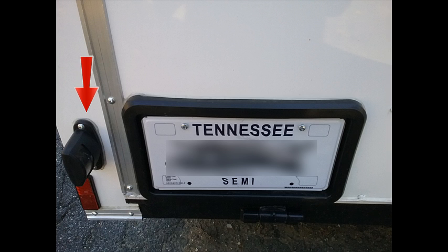Did you get that fancy LED upgrade kit all the way around? You might want to check your license plate light — it may surprise you that it's a different bulb and not an LED. I have seen this on multiple trailers that bragged about having a full LED package, when it turns out they have a simple 194 bulb in them.